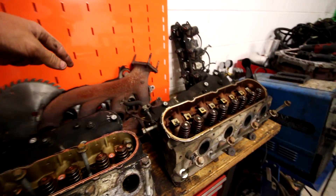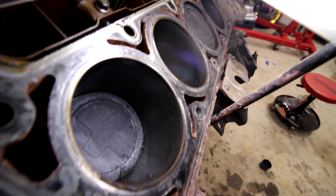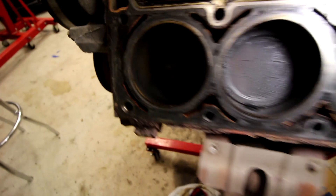I really need to give you guys an update. I turned off the AC — I apologize if the audio is crappy. I made a lot of progress on the motor and didn't really film much, but let me show you what I did. I took the heads off — here are the heads, exhaust manifolds, valve covers, coil packs. First things first, let me show you the cylinder walls. They are beautiful. This motor apparently has 140K on it, but the cylinder walls are gorgeous — not a single imperfection on the whole thing. The pistons look good.